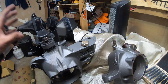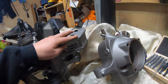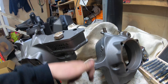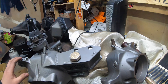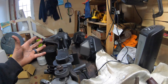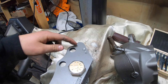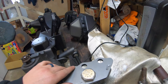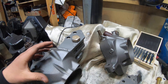Let's talk about the steering on the Dana 60 from a Super Duty going into a JK. The reason we really want high steer arms is because it's going to raise our tie rod and drag link up about three inches. If we just drilled out the knuckles and put a tie rod on there with heim joints, it's going to be pretty low hanging and we're going to put a lot of bends in the tie rod because we would hit our track bar bracket or our diff cover. With high steer arms, it's going to move our tie rod out about three more inches, so we'll have no issues clearing that diff, and our drag link angles are going to be a lot better with our track bar.